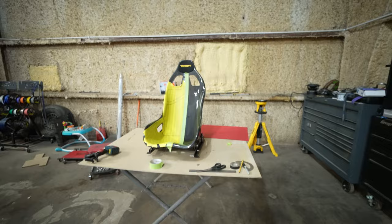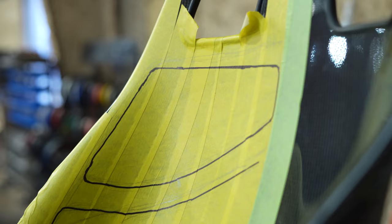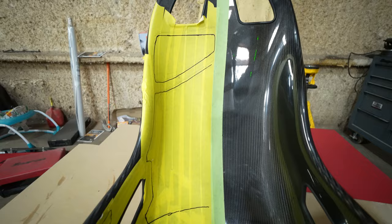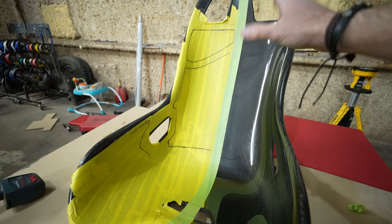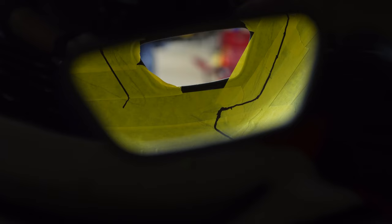I've already started the process and I have a pretty good idea of what I want — kind of that McLaren Senna style. You can see I've already started sketching out the sort of design and style I'm going for. We only need to get half of the seat designed because we'll draw that out in CAD, flip it, and have some ABS or acrylic cut out on the laser so everything's perfectly symmetrical with a perfect cut. Today I need to find the absolute center of the seat and get my templates traced out and designed perfectly.